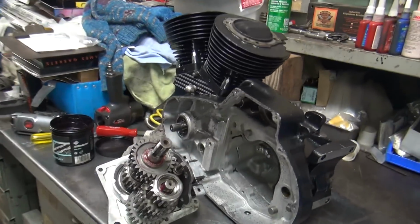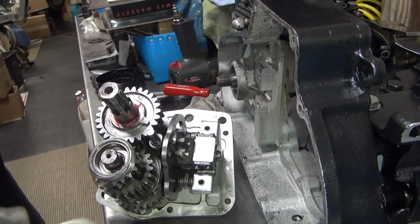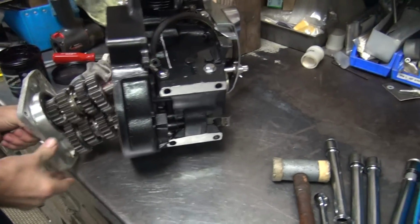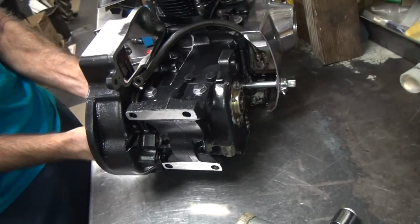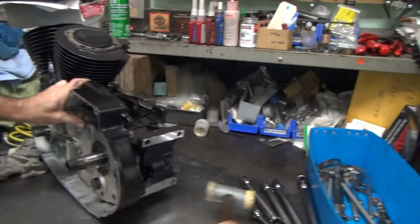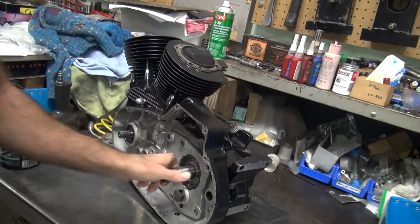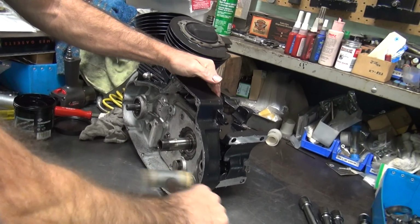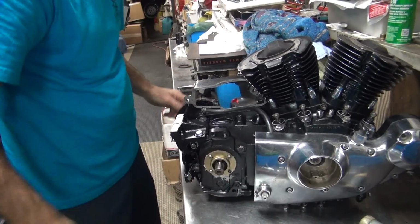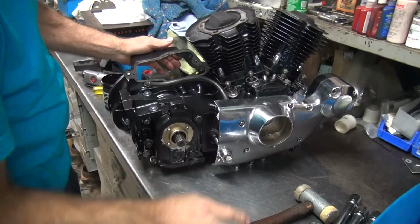Okay, now that has to be held up in the spot it's in right now at 90 degrees. It has to go right into this groove right here. It has to drop into that groove or it won't shift. It's kind of important. So I'm just kind of fishing in there. Two dowel pins, one there, one down there. Here it's solid. I feel no end play. It's hitting on it. Probably going to lock up.